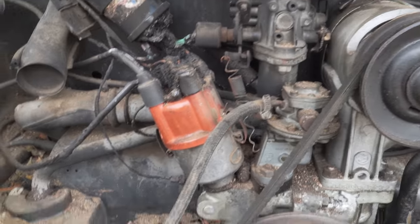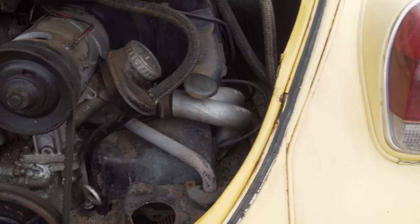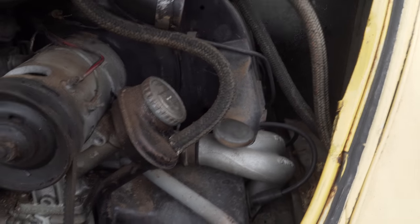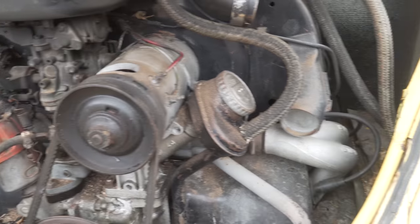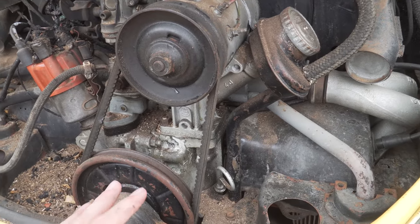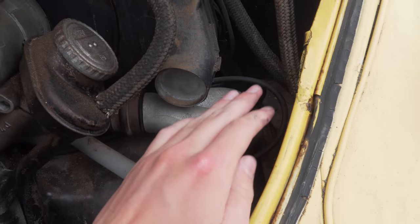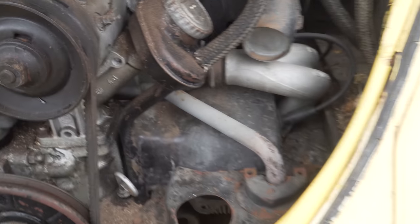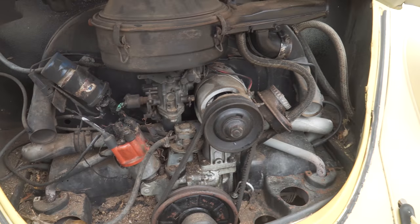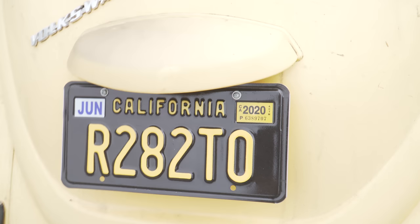After looking this over, it's not going to take a huge amount of work to get this thing running again — I already ordered all the parts and they're on the way. One thing you'll also notice is this is a dual port motor. These '70 cars were supposed to come with a 1600 single port, and '71 and later came with dual ports which made a little bit more power. So this motor got swapped in at some point. Luckily I was able to drive it before it caught fire, so I know it's a good running motor. I'm not worried about having any problems once I replace all these accessories. I'm also very happy that I'm already upgraded to the dual port over the single port, because I was planning on doing that anyway. I will be doing a will-it-run video once I get all the parts in — look forward to that, it'll probably be out next week.